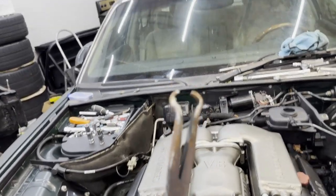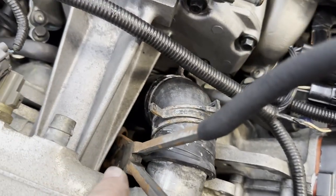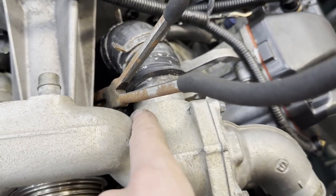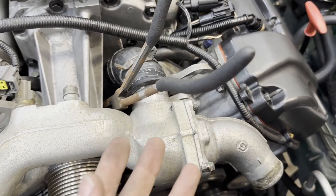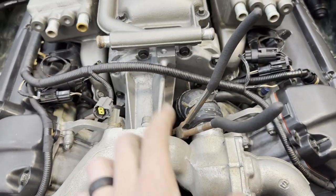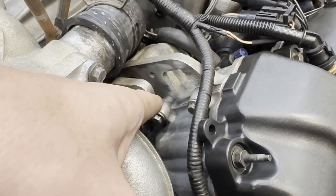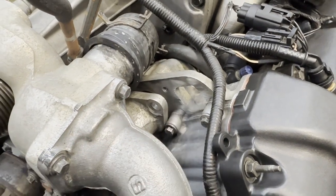These hose pliers are super super handy for this car — I bought a three-pack of different sizes. Currently using the large ones, which lets me reach all the way down in there, grip around the hose, and get a good firm grip to shake it into the connector part down there, which is normally incredibly difficult. With this tool I'm reaching in where I never was before, and while moving it I'm also seating these connections down there. I'm wiggling the whole assembly to seat all three connections in one motion. If you feel like you're making no progress, make sure the hose is past the little lip — mine was getting caught there, and once I stepped it past I had all the room in the world.